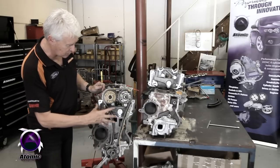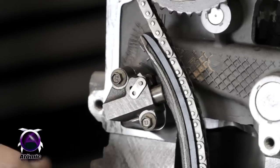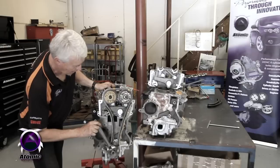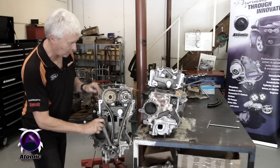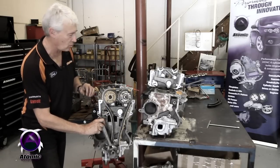Once you've got things all tightened back up again, you just pull that out like that and you can see it rocks forward. The tensioner will move depending on which way the chain is pushed. When the motor is actually started, hydraulic pressure will push it forward and it will engage onto the next tooth. That way, as the timing chain stretches and the guides wear over time, the timing chain is kept continually tensioned to the right amount.